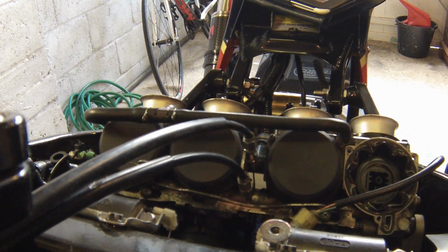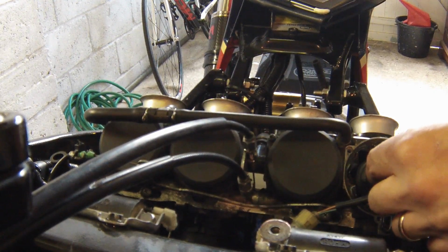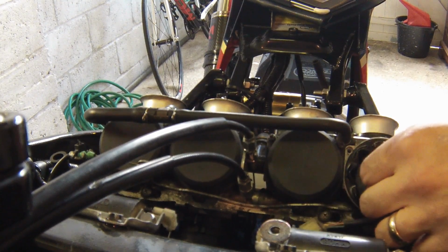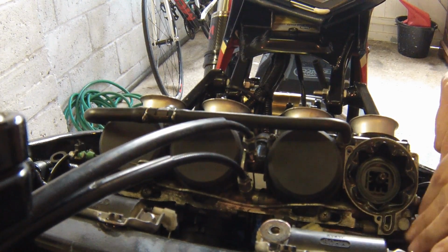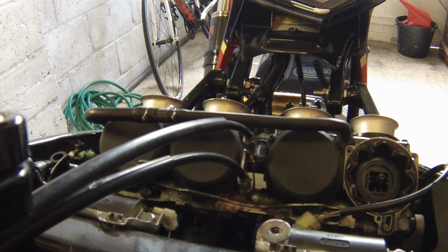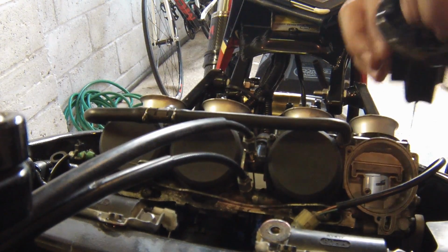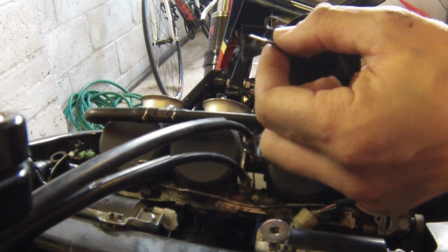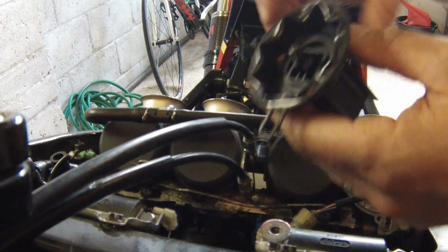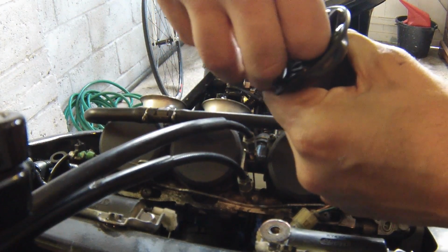If you use a screw from the cap which you've just removed, which is an M5 I believe, you screw that into the top of the diaphragm like that. Once you have that in there, you then just take the whole slide out. There's your needle at the end there, and then grab your screw here and pull, and it should click.